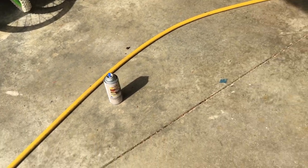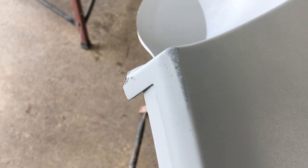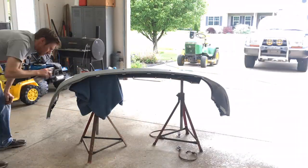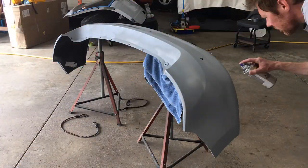I'm leaving the can in the warm sun - they spray better warm than cold. Here's how it looks after the first coat. Still looks like crap, right? Remember this picture and we'll compare later after the filler primer does its magic. I applied multiple coats allowing time to dry between each coat - each coat builds up the surface of the damaged area. This nick is still visible, this corner is starting to look decent, but that big one is going to take a lot more coats.